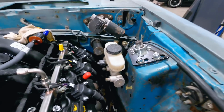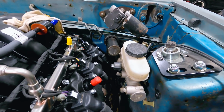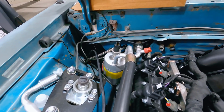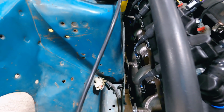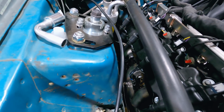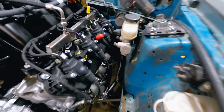All right, so here's the top side. There was the Hydro Boost assembly I was referencing. There's definitely some clearance there. So if you want power steering and power assist brakes with the Godzilla, you'll definitely have to run a '96 to '04 Hydro Boost. Over here, just some mock-up hoses for reference, manifold attachment, and then here's our AC accumulator for mock-up as well. I don't know if you guys can see down there with the heat shield on that factory manifold, it's very, very close to that frame rail. Still clears on this side, but that upward bolt hole towards the back, because of the angle, there's no room to get a stud or bolt through there to connect to the mid-pipe. So again, you're definitely going to have an aftermarket header.